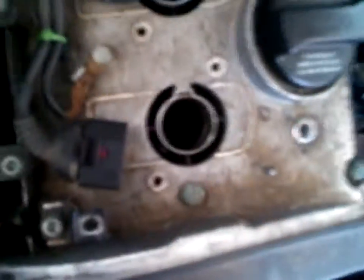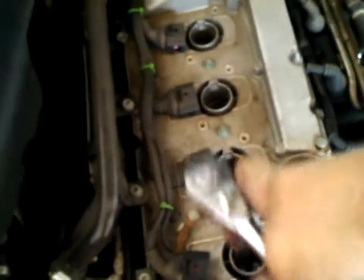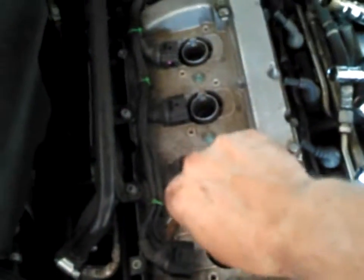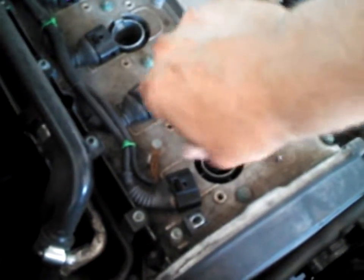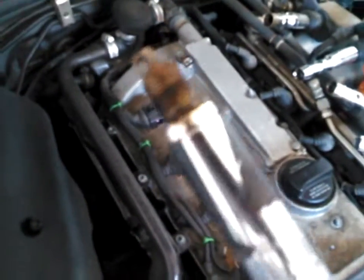So the next thing down there is a spark plug. Grab our modified socket with the electrical tape on there. Push it down, make sure it's on there. Grab your ratchet wrench. Yeah, these aren't even tight, so whoever replaced these last didn't do a good job. So once you get it past the hard point, you just turn it by hand, so you feel very little resistance, and we'll be able to pull that out. And our electrical tape holds the plug inside of there.